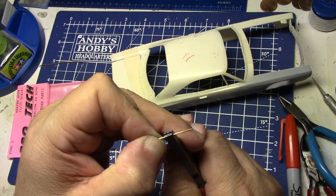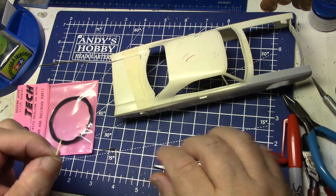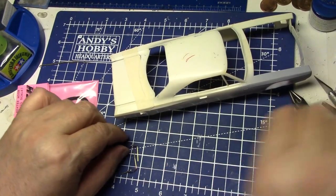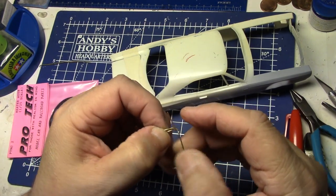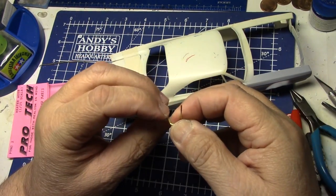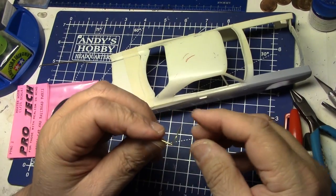This one is going to bend in the other direction. Make sure we're lined up nice and straight — it's a lot of eyeball engineering. If you want to get more structured with it and measure to make sure everything's right, by all means do that — you'll have more precision. But we can see right here we've got ourselves some hinges — pretty much opposite but equal. I'm probably going to trim this down a little bit, but let's make sure we've got these all bent in the right spot where everything's going to be equal, because if you get this off too much your deck lid won't lay down right.